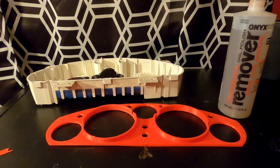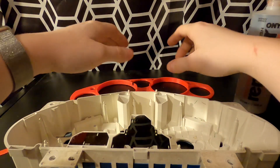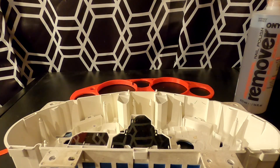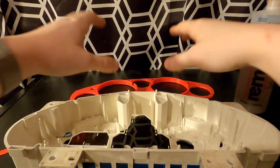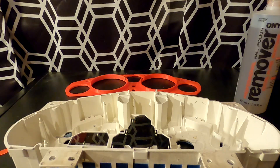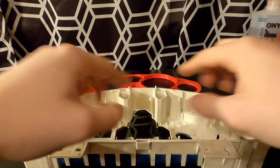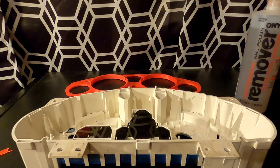The idea behind this whole project is that there's going to be a plate here that the gauges sit in. Originally I was planning on reusing the original black front bezel, but after playing around I found I'm not going to be able to do that — this 3D printed piece is actually smaller than the original. So I took the dimensions off the original front bezel and created a flat plane with holes punched in it that line up with those. The holes in the new panel are slightly bigger so they won't interfere, and there's a little wiggle room. I already designed and printed it, so let me grab that.